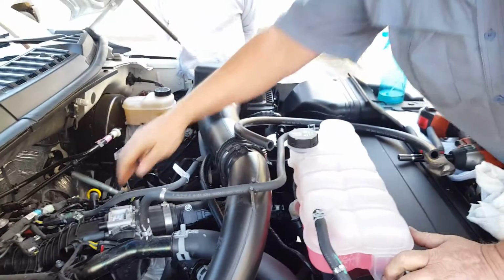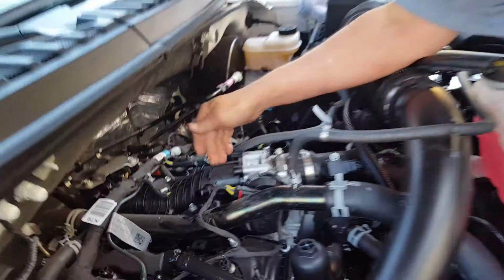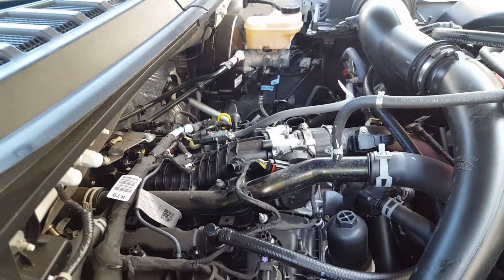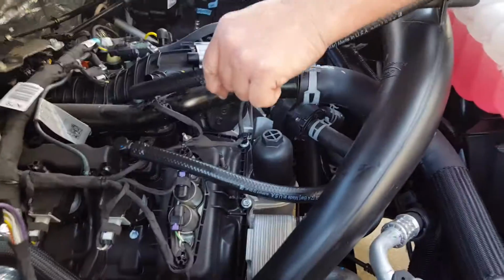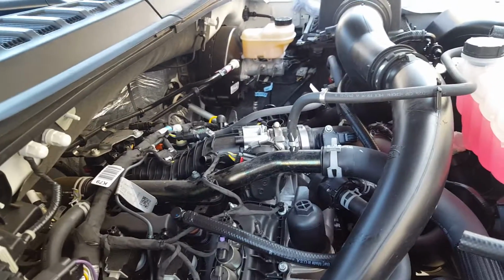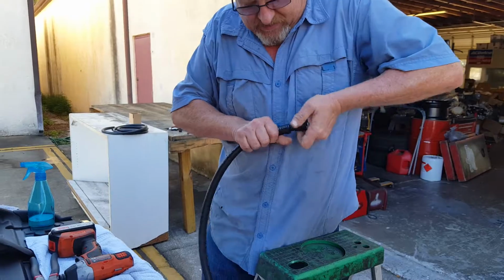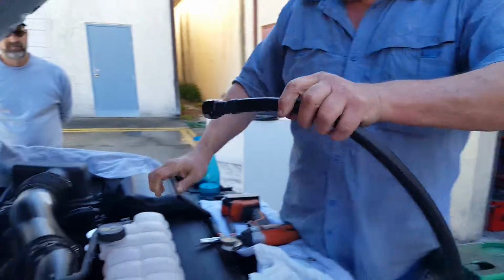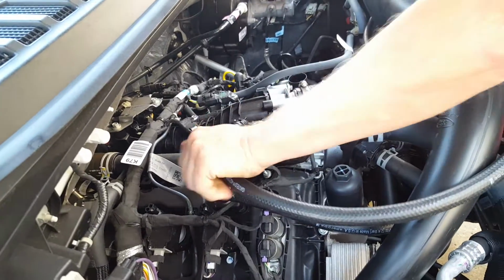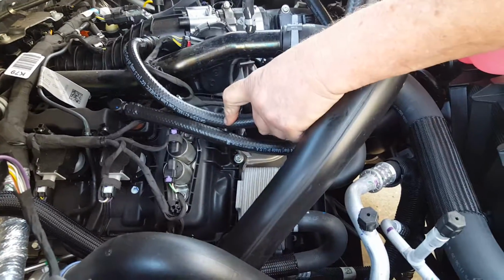Next thing we're going to do is come off the intake manifold inlet, which is our intake manifold vacuum source, and we use the straight connector for it. That is going to come around to one of the outer fittings on the can. And that snaps directly on like that. And Mike, we could use a 90 here if we need in the future.